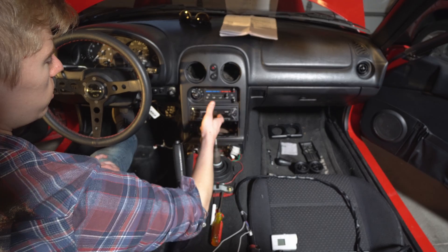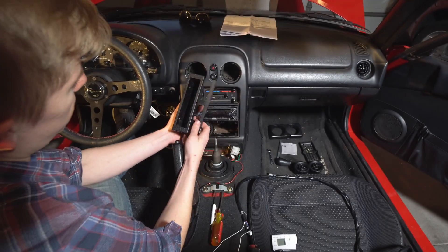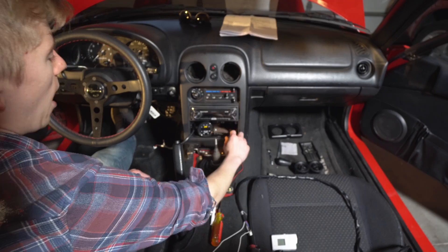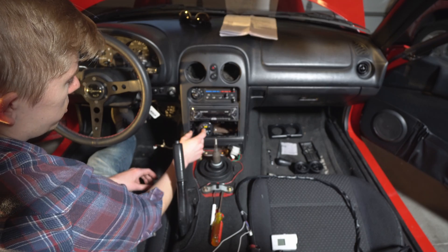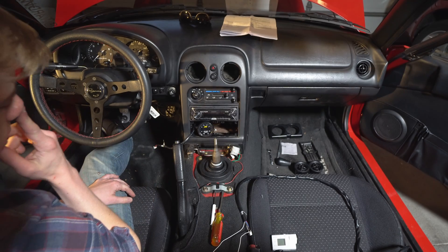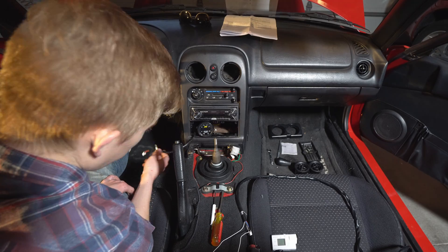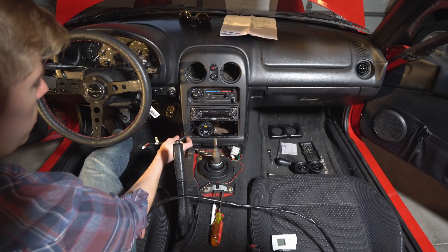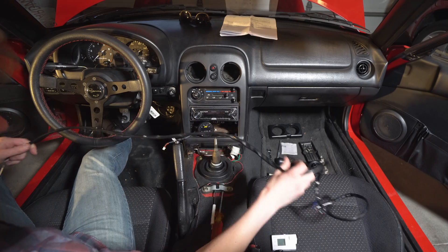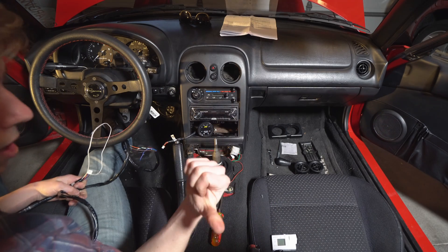What I did was take my radio out and remove the aftermarket cubby here. I will eventually make a little plate so this is more secure than just wedged, but we are going to wire in this wideband right here. That connector goes to the actual O2 sensor in the engine bay, and then we are going to wire power to the controller and the analog signal to the Megasquirt.